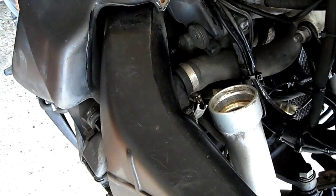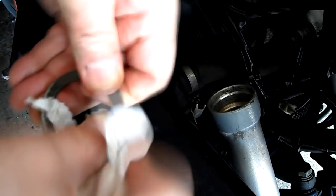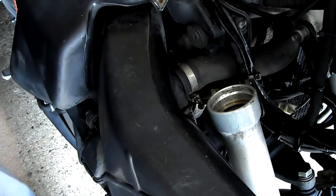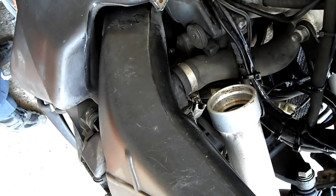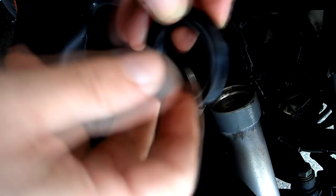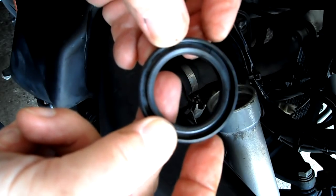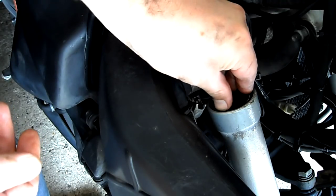Once you clean the fork tube up, it's just a question of reassembly. First in is the washer — nice and clean — just pop that back into the fork tube where it came from. Now you'll be looking for your new seal. Make sure to inspect it before you put it in — check there are no cuts or nicks in it that would let oil through. You've got the large groove on one side and the small groove on the other. The large groove has the oil scraper ring on it, which goes to the bottom. Just gently press it in with your fingers, making sure you don't damage it in any way.